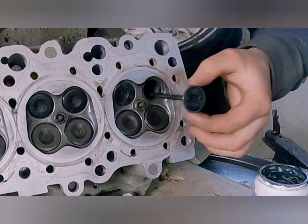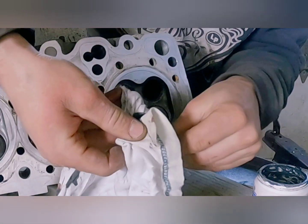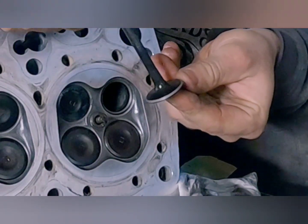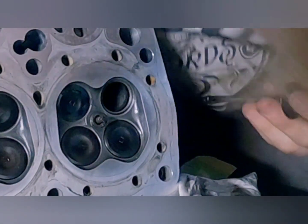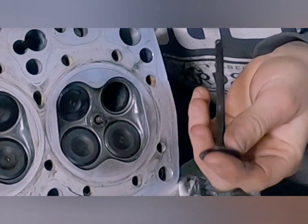This is the last two valves I have to do. So I'm just going to clean these off. Both are clean — examining every time, being as meticulous as I can. If it looks good, you're done. If it doesn't, you lap it again. If it doesn't look good after that, you lap it again.